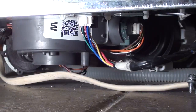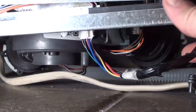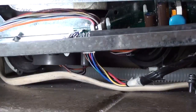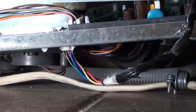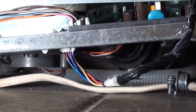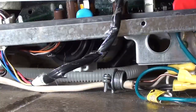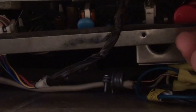I took out those couple of screws, and now I can drop this panel. You can see the control board — and there I see the service LED blinking. Let me turn off the light so you can see it better. There — see it's blinking once. That's the service LED in the middle of the control board.